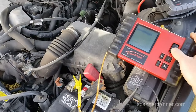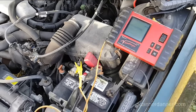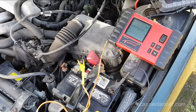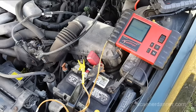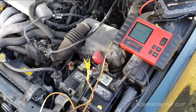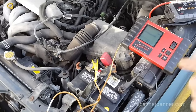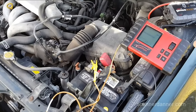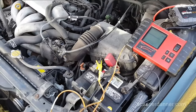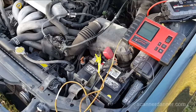Let's change the scale. Look at all that ripple in there. I'm not going to panic yet because this battery is dead. Just so you know, Caleb, 14.2 — a fully charged battery is 12.6, so if you're charging at 14.2, that is going to charge the battery. That's what we want to see. The alternator is at least producing. That squeaky belt is super annoying.